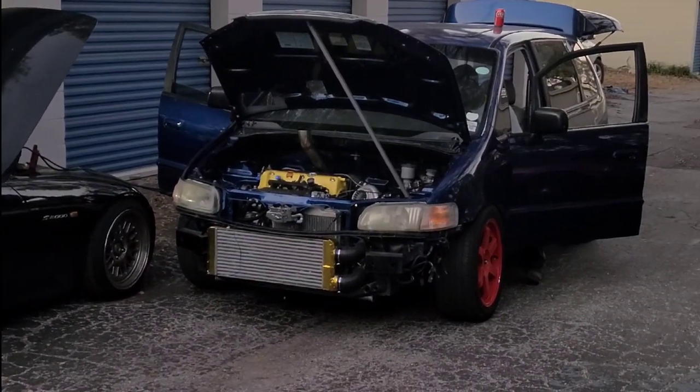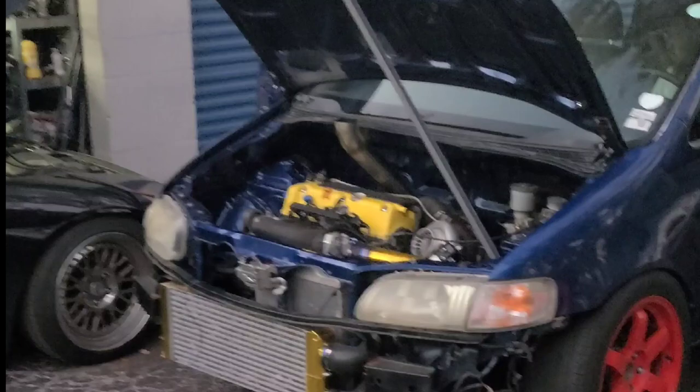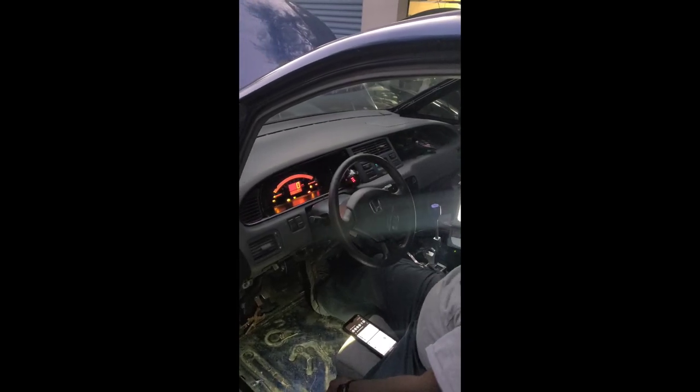So in these videos, what we're gonna see is I had a number of problems. One, my fuel line — I had two fuel lines crossed backwards. Y'all know I did my own fuel cell job, so you know it's whatever. And then we found out the MAP sensor was actually burnt out and there was a broken wire in the harness, so at this point we basically called it a night.